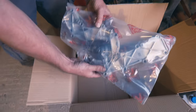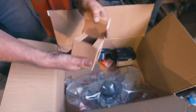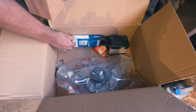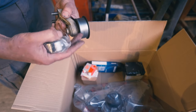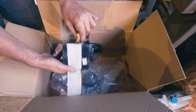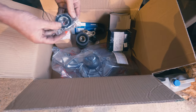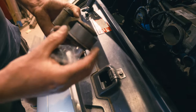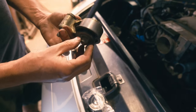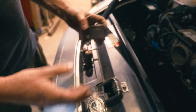We've got some bits here. There's our new water pump, the impeller protected by a cardboard cover, and a new gasket. We've got one little tensioner bearing - that'll be for the auxiliary belt. So that's the idler bearing. We've also got a new tensioner - actually, that one is the idler and this is our tensioner. I'll have to take that out and replace the bearing in there. It looks like that part comes off and then the bearing will press out - so that's a job for tonight.